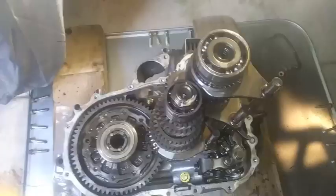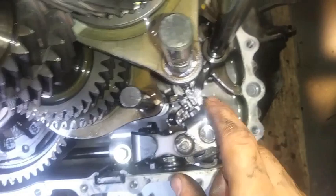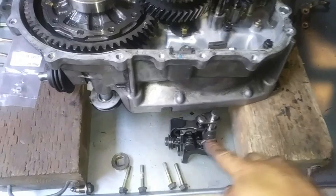Right now I'm going to take off the gear sets. You have to take off this size 10 right here, this one, this one, and also these two — this one and this one — they're both size 10. Then you're going to be able to take the gear sets off, then we're going to be pulling the differential out. So I took off this piece. These three bolts — I put them right there. Now I'm going to take off this little bracket.